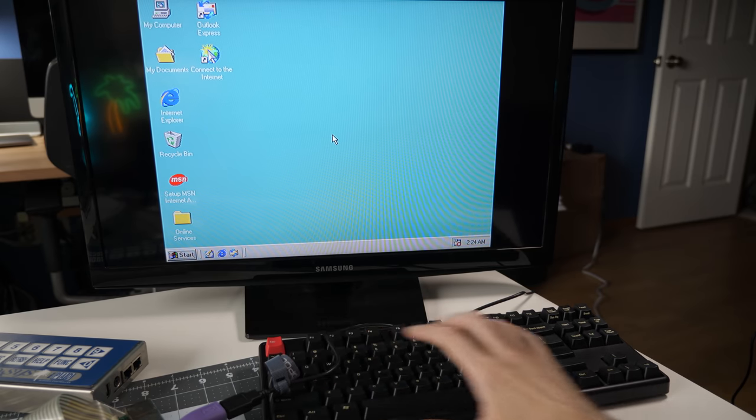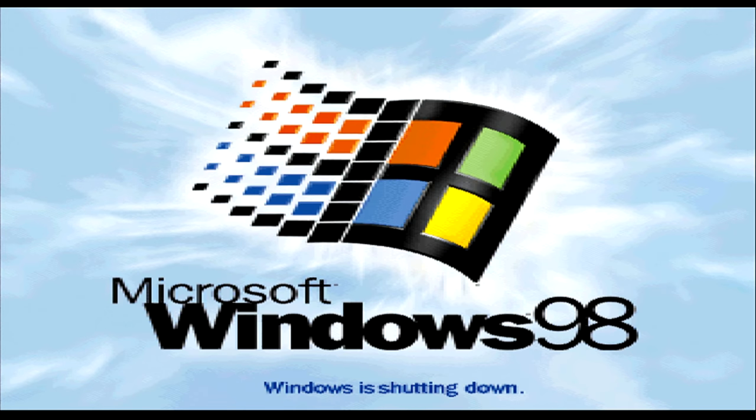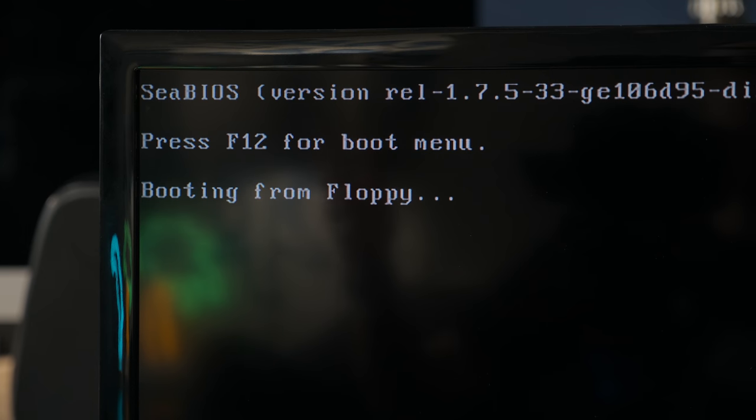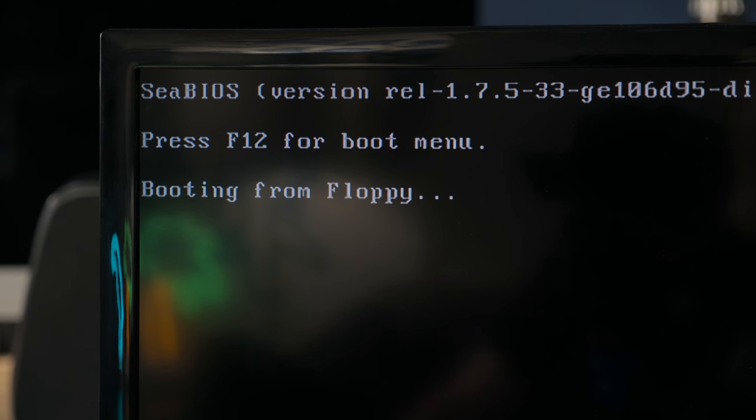And, well, if you go and reboot, and I'm going to let it go ahead and try to start up like normal. Yeah, Windows kind of bricked it. This unit is permanently stuck at the booting from floppy screen now because apparently those first couple sectors on the disk actually do matter, at least when it comes to XDOS. Basically, I think Windows overwrote the little bit that tells the A drive it is bootable.